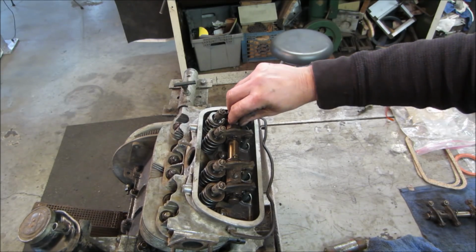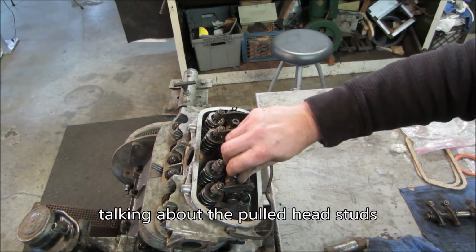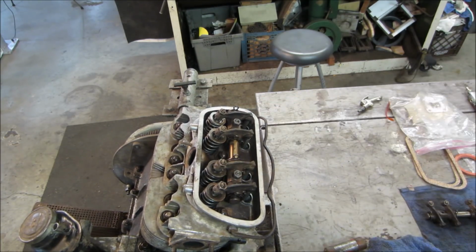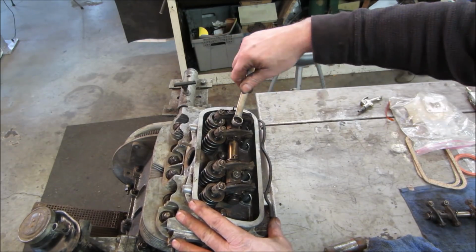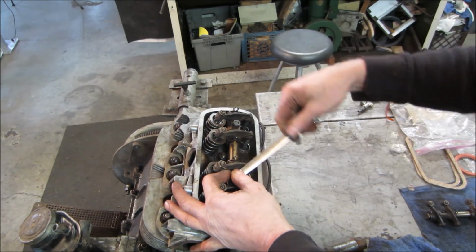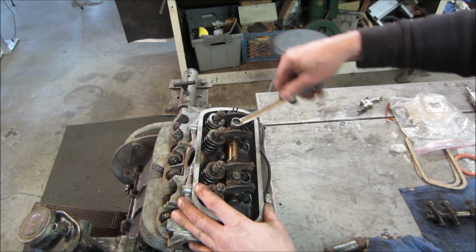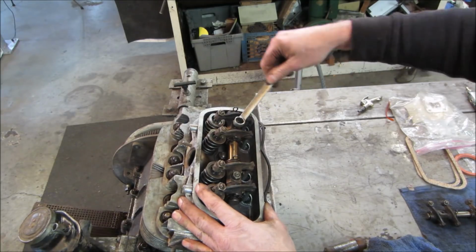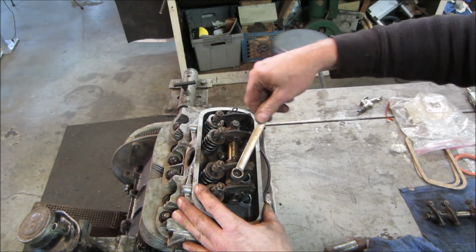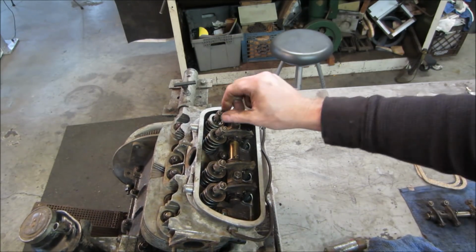What'll happen is it'll run, but number 4 cylinder is going to have blow by because of that issue. It's not like it has a constant exhaust leak whenever you get on the throttle. That's when I was taking the jugs and I was trying to flatten them to the head. That's what I was talking about then too. Same problem. Generally it's from overheating. And the mouse nest that we took out of this was a good example of what causes an issue. We have to go back and adjust all of them.